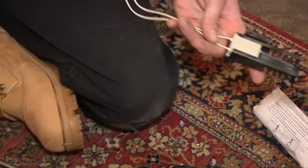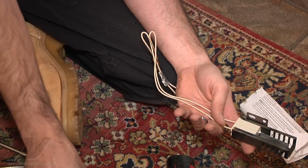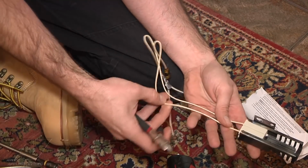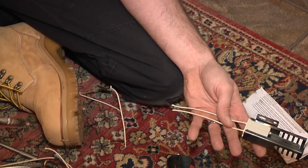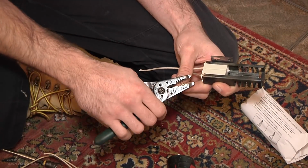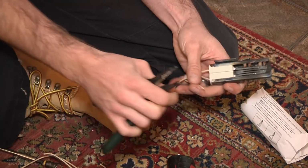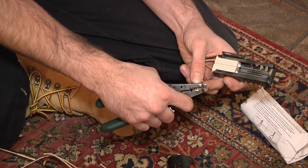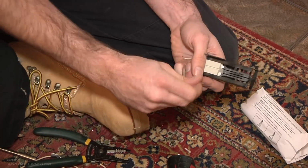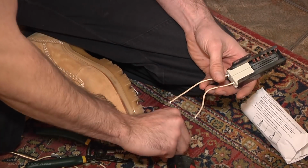And we are going to prepare this igniter here just by cutting the wiring off. Give yourself a little bit of extra slack. You know, that's how short you cut the old one. But give yourself an extra couple of inches. The wiring can be tucked back behind the panel. Just cut that off there like that. Now we're just gonna strip these wires down about a 1/2 inch also. Just like that. Now we're ready to go ahead and install this.